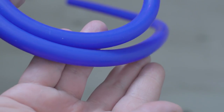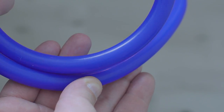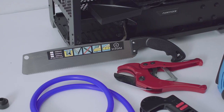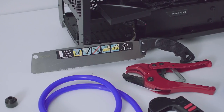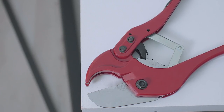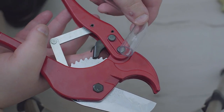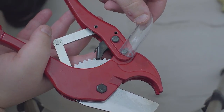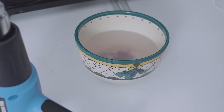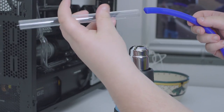You also need a silicone insert that is the same diameter as the tube's internal diameter. This is flexible and its role is to prevent kinking when you bend the tube. You'll also need something to cut the PETG — I have an AlphaCool saw which gets the job done, although it's not as easy as other options. Alternatively you can use tube cutters; even a basic one will provide a reasonably good and fast cut. Last thing you'll need is water with a few drops of liquid soap to easily get the silicone insert into the tubing.